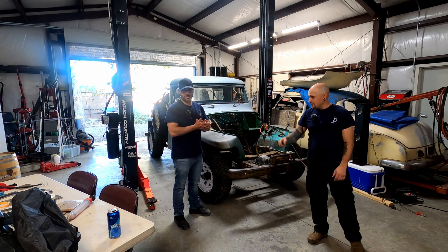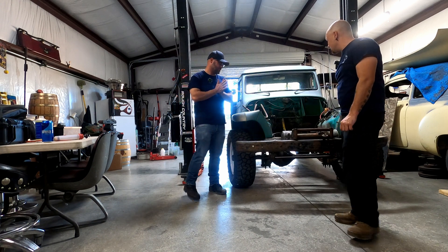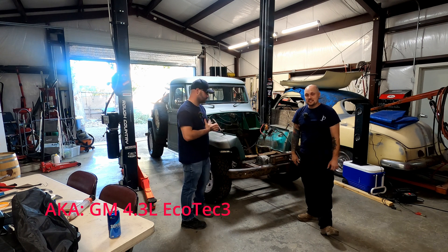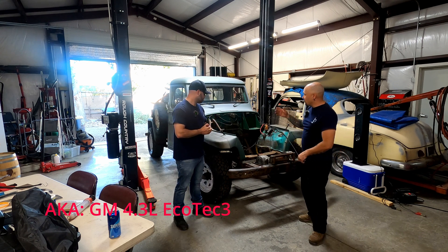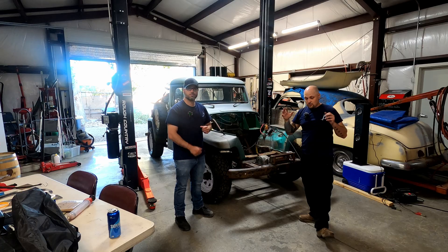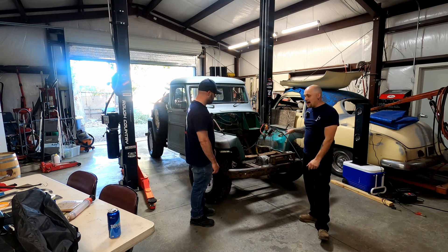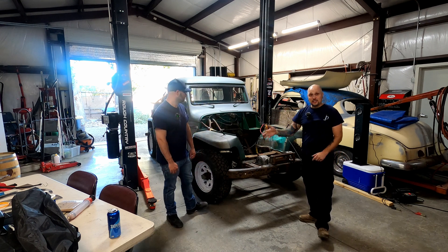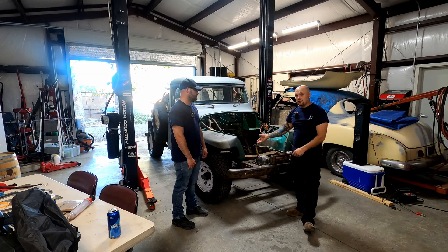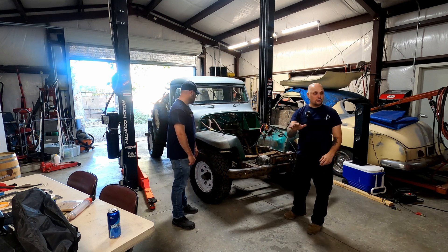What's up you guys, JP here with Trent. We're finally getting on the 62 Willys project. We're gonna be installing a 2018 Vortec V6 — it's the 4.3 from GM with a 6L90 transmission attached. The transfer case isn't currently here but we'll be getting that from the customer. He'll be doing the axle swap because the axle on the transfer case is on the driver's side whereas the axle on the front of the Willys is on the passenger side, so there's gonna need to be some updating in the front end — the customer can handle that.